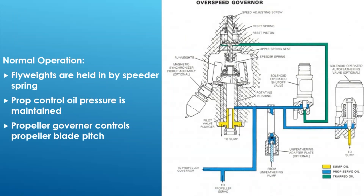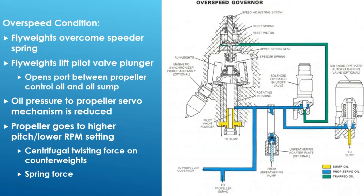This is a backup system. If our propeller governor fails and doesn't work correctly, we don't want the propeller to fly apart. Centrifugal force is the greatest force on a propeller, and it increases very quickly once you get into higher RPM ranges. If we start to overspeed, you have the potential for the blade root areas or bearing tracks to fail, and have the blades detach from the hub or the hub itself crack and allow the blades to come out.